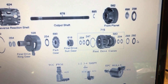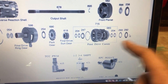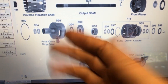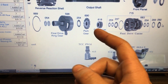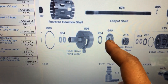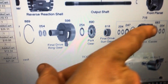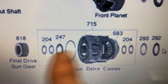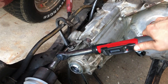This diagram confirms what I did was correct. Part 292 is the bearing and part 293 is the washer — they're exactly the same ID, which fits around the end of the diff. Also, the final drive gear has a beveled edge on one side and the inner teeth are set in slightly on the other — that inward side goes towards the transmission body. There's a bushing on this part gear, and it has a collar sticking out toward the side away from the transmission. Anything already in the box is already installed in the diff. These four 13mm bolts are, I believe, 15 foot-pounds.